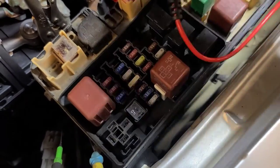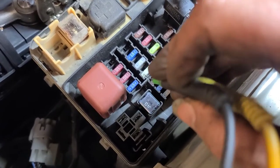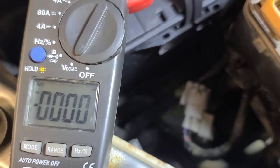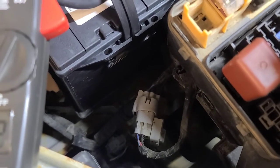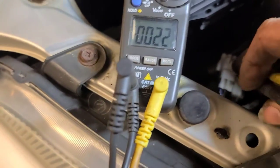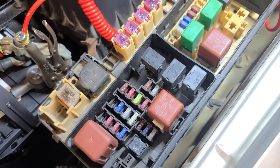And so I've got a voltmeter connected, and I'm using two very sharp test probes. And you can see across that fuse it's zero. And across that fuse it's zero. So none of the fuses that I have access to, I can read a voltage drop across. So it could be one of these main fuses, and you can't test across those conveniently.